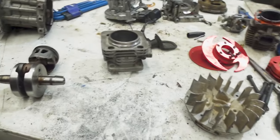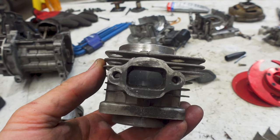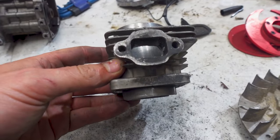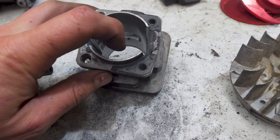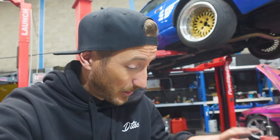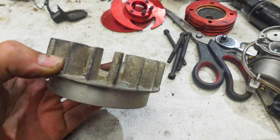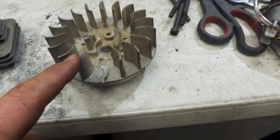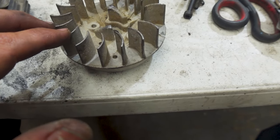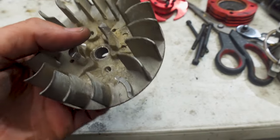We now have all our custom machined parts, hand machined with the dremel. The exhaust port is significantly bigger — we raised the roof by quite a bit, hopefully not too much. All the ports on the head are dremeled out as much as I'd like to take it with my very limited knowledge. The last thing we're going to do before cleaning up and reassembling is lighten the flywheel. Flywheels have a bunch of fins on them, so we're going to remove two fins, skip two, remove two, skip two, remove two — to lighten the flywheel and minimize the rotating mass within the motor, which should help it rev a little easier.